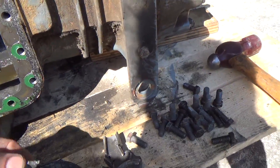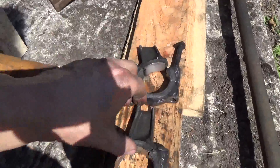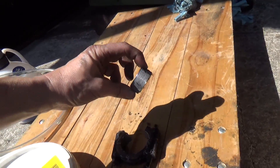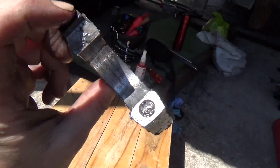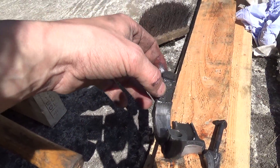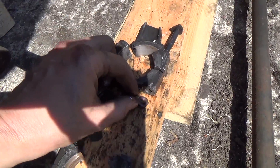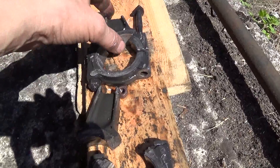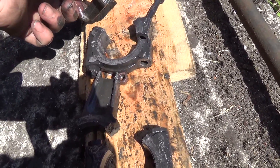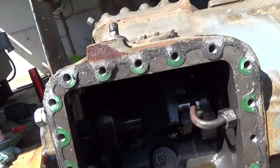That's what we think happened, and it certainly ties in with all the parts we've found and the particular damage, because this one also seems to have the least worn bearings. These other ones are quite badly scored, but that one's not too bad. It looks like this one might have let go first — that nut fell off the end, came loose, and that just allowed that to chatter until it metal-fatigued on either side. Then once that went, it goes around until it catches on the block and snaps off, just chewing all the pistons up and everything.